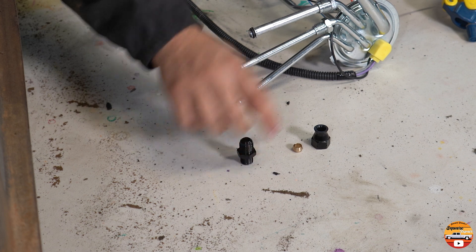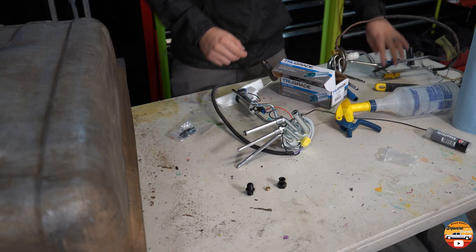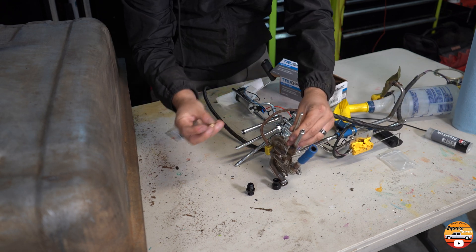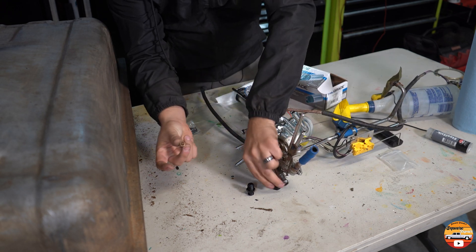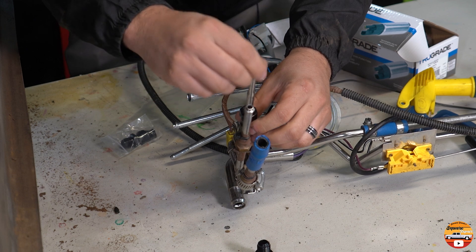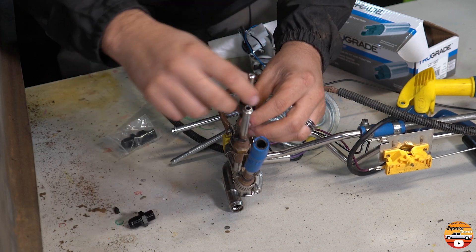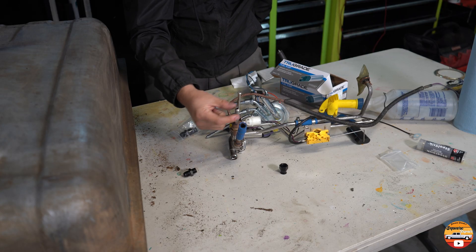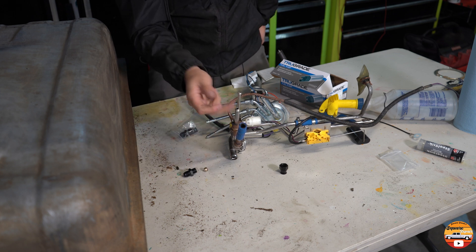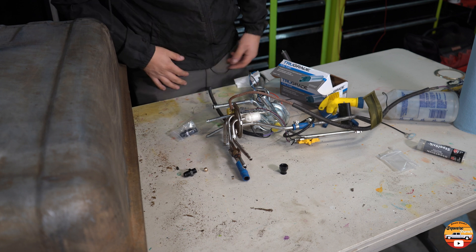These come in different sizes. The ones I have are 5/16s and I've also ordered some 3/8 ones. In the meantime, we're going to use our old sending unit to test out whether these will actually work without leaking. The way these function is you have your little ferrule and your base piece. We're going to slip that base piece on, then slip the ferrule on and sandwich the two together, and you have an AN6 fitting. What we're going to do is cut these ends off so our ferrule can slip over the bare tube without the flared end. We'll use our old one as a base - if it works on the old one, it'll transfer right over to the new one.